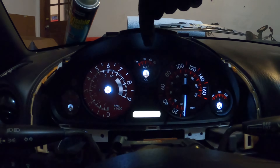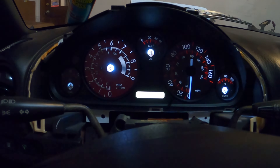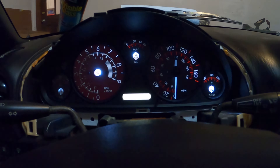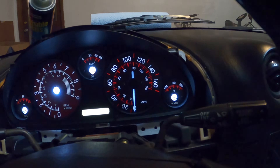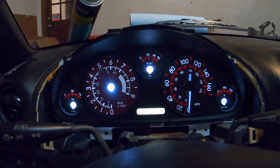This is my first test run. You can just install the very top middle connector — the one that goes right there in the back — and flick the lights on to see what's working. In this case, it looks like half my tach and half my speedometer are not lit up, so I'm going to flop a couple bulbs around and see what happens. There we go — now everything is actually lit up, so that's better.